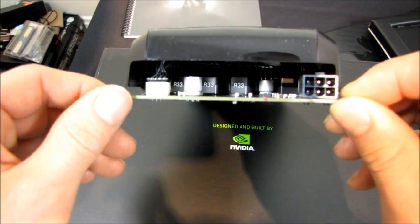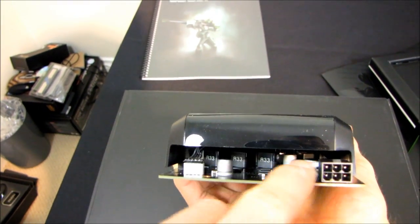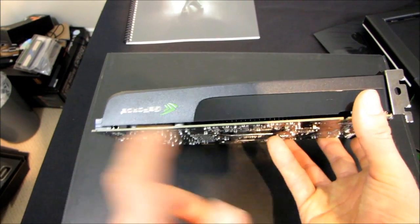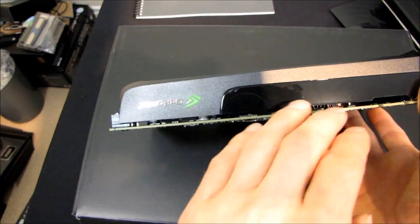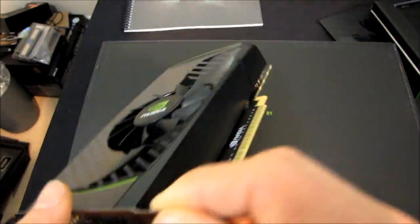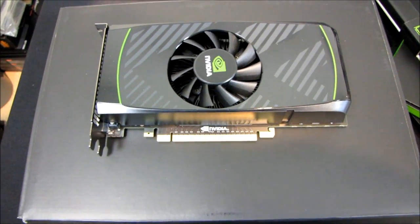There's no heat sinks on the power circuitry, but there is a fair amount of airflow coming from the fan going over the power circuitry because there is absolutely nothing restricting airflow in that direction. The GTX 550 Ti is going to be a fairly internal exhaust card. Along the entire top of the shroud there's a fairly substantial gap that's going to allow air to come out, cool the memory chips, and cool components along the card. Same along the bottom. While some air exhausts out the back plate, most of it comes out the top, bottom, and back — maybe only 20% is externally exhausted. This isn't going to be a very hot running card, so that shouldn't be a huge problem.